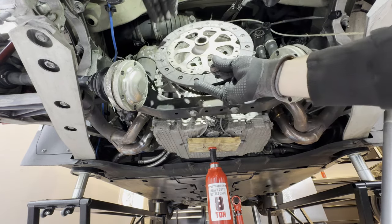Before hooking up the shift cable ball and socket to the shift mechanism, undo the slave cylinder plug and plug in the hydraulic line. Pop the little rubber nipple off, plug the line in, slide the metal bracket in, and secure the clutch line to the transmission. Now clip the clutch line in. Then take the shift cable and push it onto this ball. Attach the shifter cable on the passenger side — you may need a new little bushing there, linked in the description. Plug in the reverse light switch to the transmission and route it into the little clips.